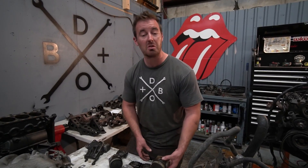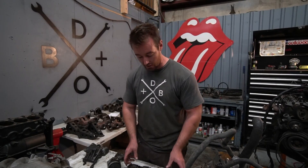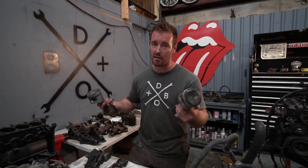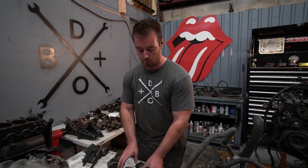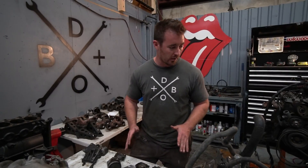To be honest with you, I had no idea there were two different 325i pistons until I went out and started digging through motors this morning — and we found the two different pistons. Now we know why there's so much arguing on the forum posts. Hopefully that clears up some of the stroker debate.